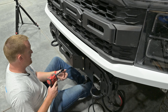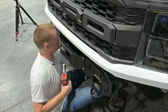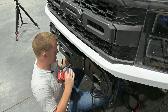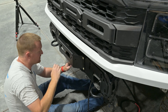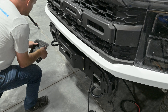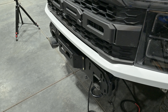Now we'll tighten the winch up. I like to push it up as high as it will go to start with. Just watch out that it doesn't hit the blow-off valve or anything back there. Now we can remove the masking tape that held the nuts in there. It's also probably a good time to remember to put these on — I swear every time I do it, I forget until after the bumper's on, which you can do but then it's a pain.